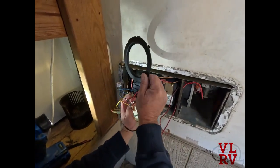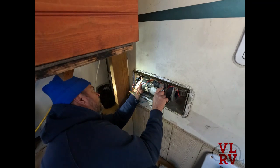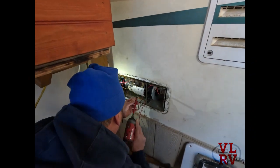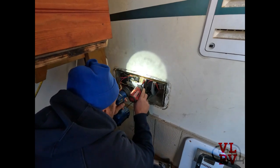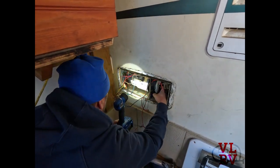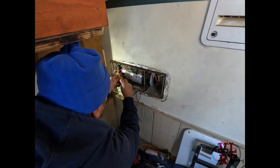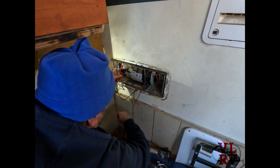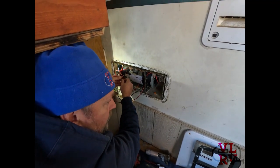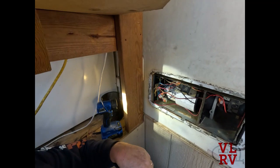There's a plastic wheel in there — I think it's an air diverter to help draw air to the squirrel cage. I've got to get that lined up between the two halves here. The newer furnaces are a little bit easier to work on. One more connection and we're wired up. I'm going to go ahead and bump it again just to make sure nothing's grinding or rubbing.